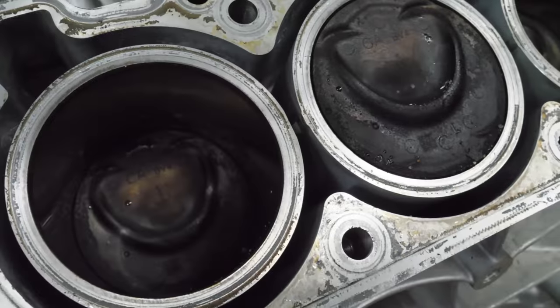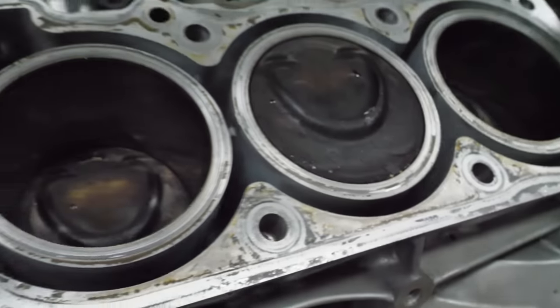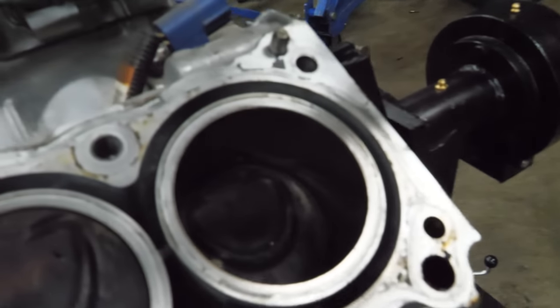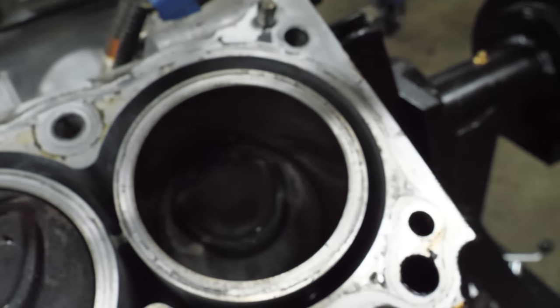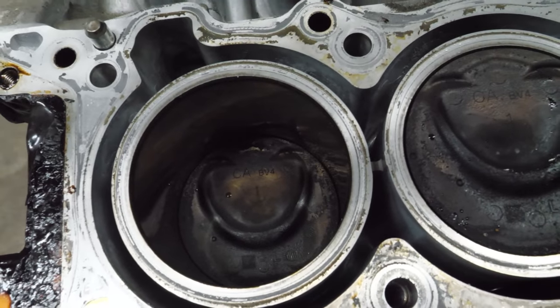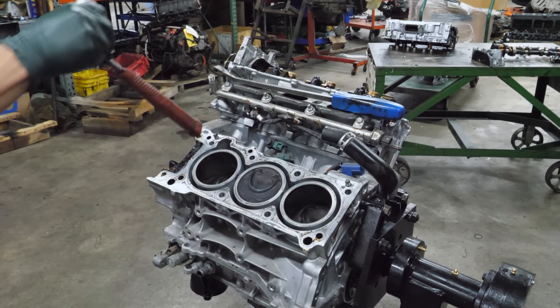I think it's done. The block looks really, really good. I don't really see a lot of wear in the cylinders. There's no marks from piston to valve contact. Everything's in one piece. This was the side that had a chain still intact. I'm sure this will pass the test